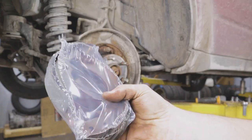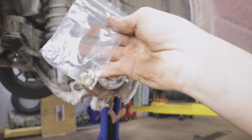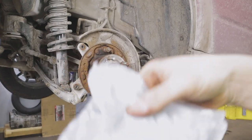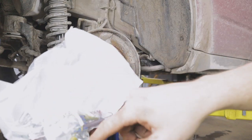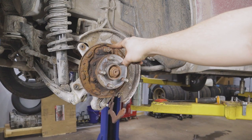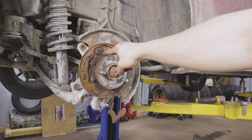When you go ahead and order your kit, you're going to get a box of four shoes — two for either side — and with those you'll get new horseshoe clips. Don't forget that you'll also need to order a component kit with all your springs, adjuster screws, and brackets. The only things that don't come in these kits are the little triangular bracket that sat behind the two top springs and the half-moon shaped bracket with the square spring that sat just behind your hub — make sure you keep both of those.